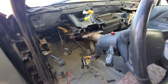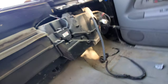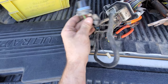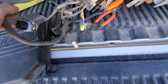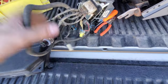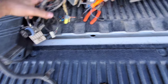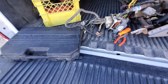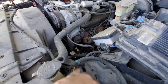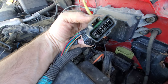There are a couple of differences between a 97 and a 98: the main plug and the headlight harness use different connectors. Here's the headlight harness out of a 97 — it's a round plug. The wires are the exact same colors from a 97 to a 98, but they did something slightly different with two green ones. Both have the airbag stuff. Here's a 98 parts truck — as you can see that plug is different, same colors but a different plug shape.